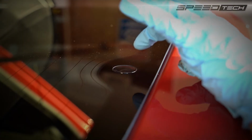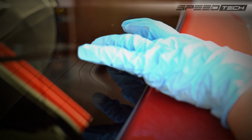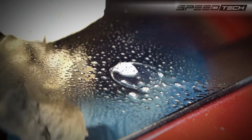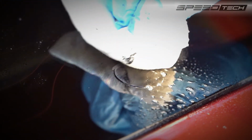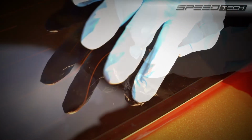If you need to make any adjustments, simply apply pressure to the front or back of the glass plug. If any of the glue squeezes out, you can simply wipe it away. If you find any larger gaps in the adhesive, fill them with adhesive from the outside. After about 12 hours, the glue will be fully cured.